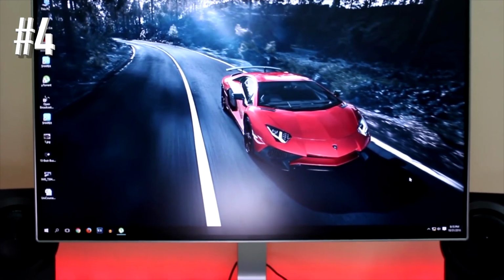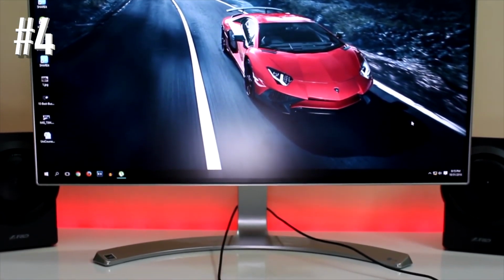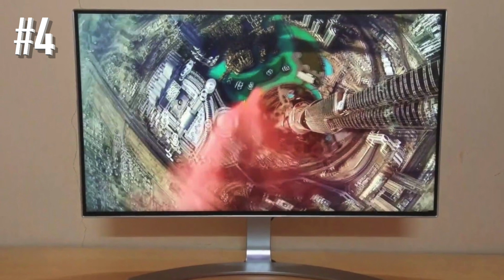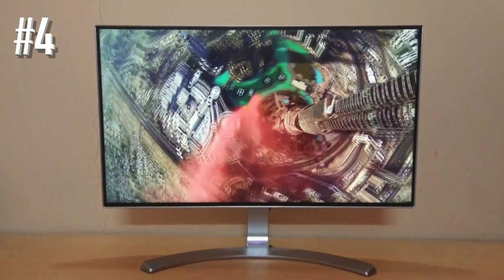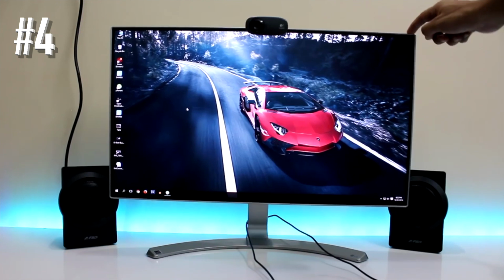If you want to build a dual monitor setup with 2 of these LG products, it's best to use a dual monitor arm right off the bat. But take note that the VESA pattern on the back panel is 75 by 75 millimeter instead of the usual 100 by 100 millimeter. If your second monitor is different and has the more common 100 by 100 millimeter VESA mount, make sure that you buy a dual monitor arm that supports both sizes.